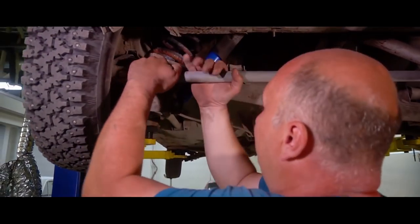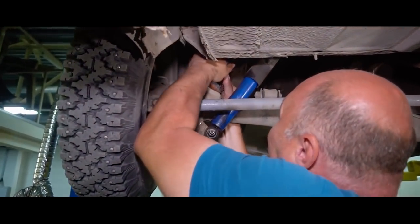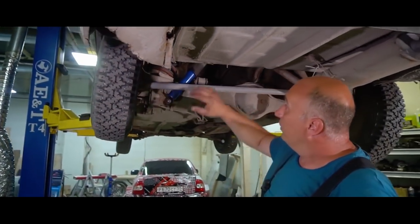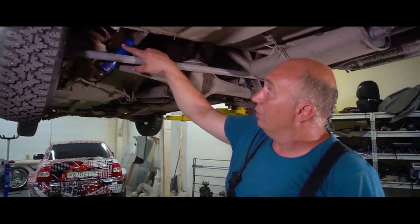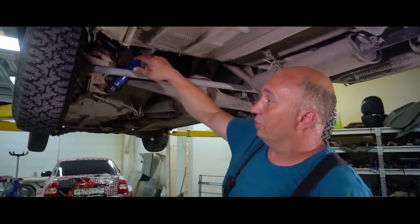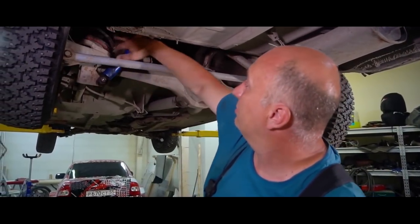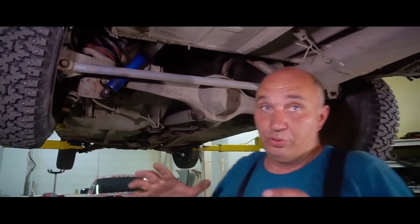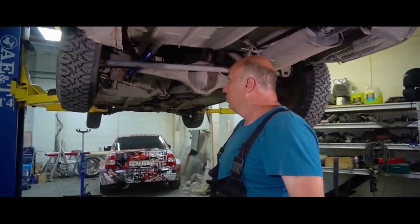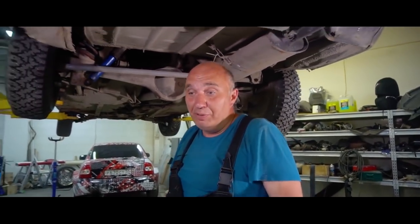Let's check on the left spring. Oh wow, it is jammed in there. This one I can't retrieve, given that it was a bit longer. You can see that it toppled to the side. Some of the coils are pressed together, while others still have a gap in between them. You don't have any space on this side, but there is a bit left here. It was able to keep the car a bit higher off the ground, but it definitely wasn't doing much else. Then again, that's the whole point of an experiment.